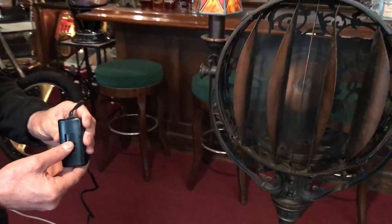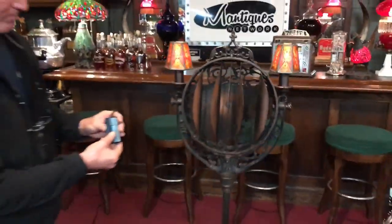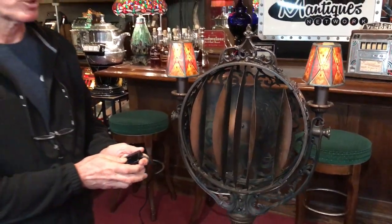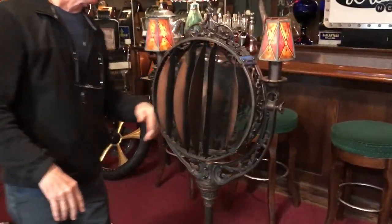This thing really cooks — see, it's going pretty good, going real good. You can back it off and run it at a lower speed. We put a brand new motor in here, which is the beauty of this. This fan has been completely rewired as well as fitted with a brand new motor, and we were able to keep the original fan motor housing. We got a motor that fit right inside of it, so we sandwiched a brand new motor in here. All new wires, all new electrical, new motor.